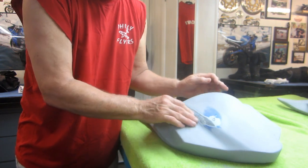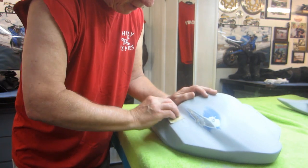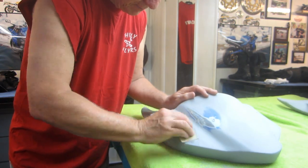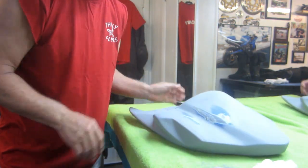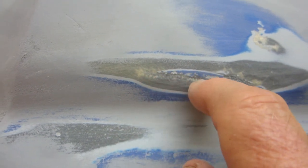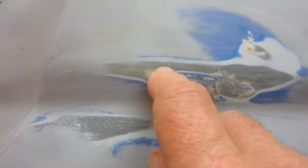Now that one didn't come out, so that one's going to need some attention. I always find these spots with my bare hands or with gloves — that's always the method of choice for finding little spots. Now just to show this up close: the problem with doing this kind of bodywork is there's fiberglass, and this is the cloth of the original part. We've sanded through the gel coat because there's been such damage here. This is the worst spot down here — but once you sand through, you have no choice.